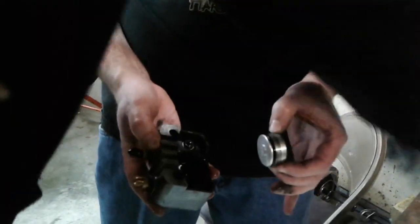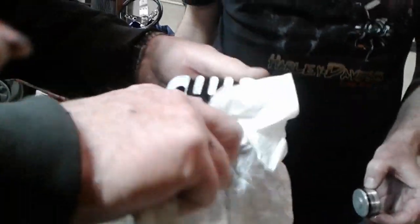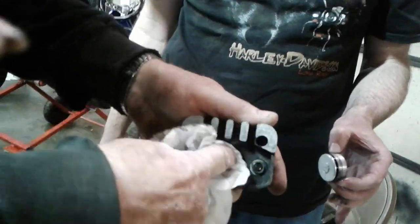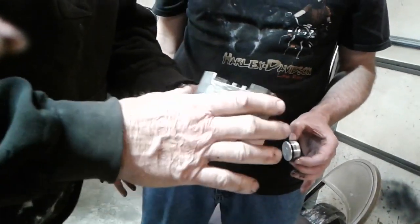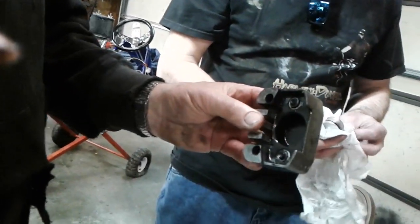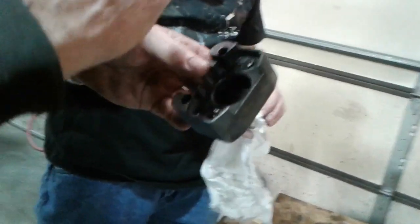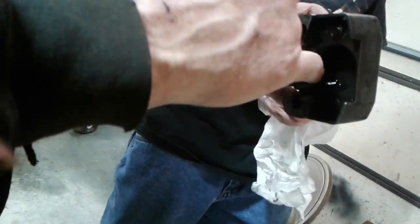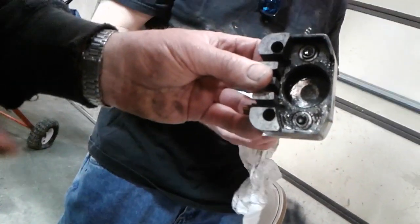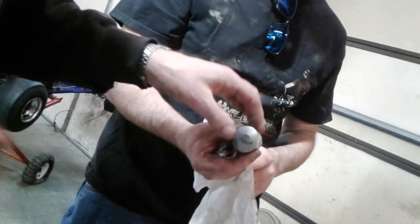So that's what you got. Now we're going to talk about a couple things. I'm going to dump the excess fluid out, wipe this bore down and inspect it. This is on a single-engine cart so we don't have much problem with that. But on our dual-engine carts where you've got a bunch of horsepower and extra weight — when you put the brakes on, it slams that puck forward and I've had them pocket this area out. When that starts to pocket out, it doesn't matter how many sets of seals you put in there — you cannot fix that brake. Your caliper unit is junk at that point. That's something I've seen on our duals.